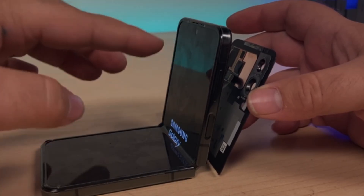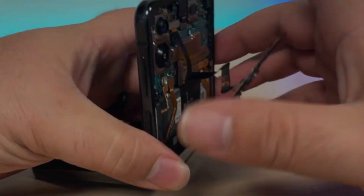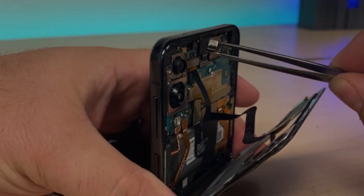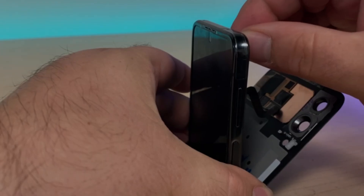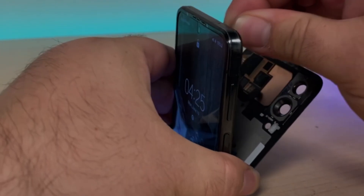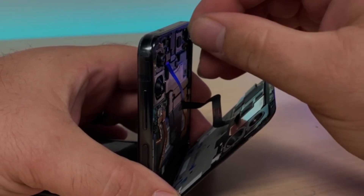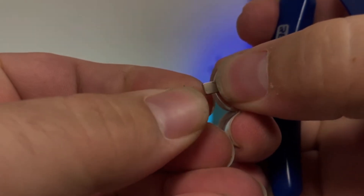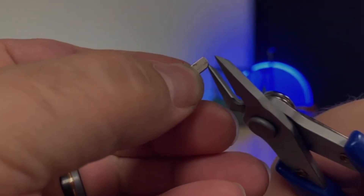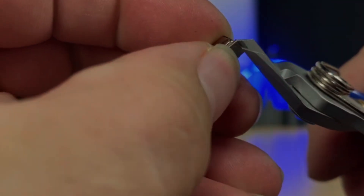Here's where things get tricky. Replacing the frame or screen can cause the phone to not detect folds correctly - the screen may stay black when open or misbehave randomly. Even the tiniest misalignment of the hinge magnets, often just a half millimeter, can throw off analog or hybrid sensors. Older analog devices can usually be fixed by carefully repositioning the magnets. With hybrid models, slight adjustments might help but sometimes partial calibration is needed. On fully digital models, the magnets basically just hold the phone closed, so those phones rely on firmware calibration stored in the hall IC - mechanical fixes alone won't cut it.